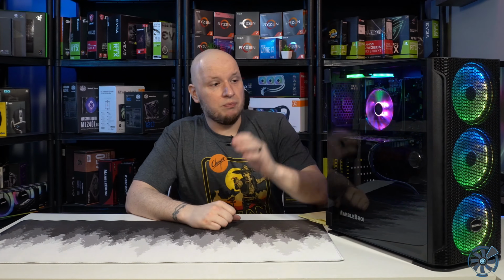Alrighty guys, so I'm gonna try to wrap this one up as fast as possible. I got a little bit of information I want to run through here before we do that. So depending on the title, this was anywhere from 5 to 20-ish% lower than my test bench with the 1060 in it. That's probably in part due to the fact this has lower clock speeds because it's an older Intel chip, and the fact that the memory was slower at 2133. That makes more of a big difference on Ryzen versus Intel, but I'm sure it played a small factor here.